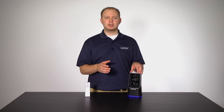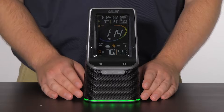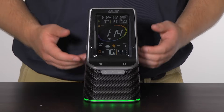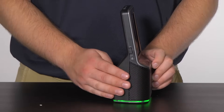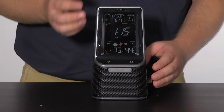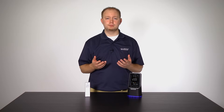For the backlight adjustment: if connected to the AC adapter, you have the ability to control your screen's backlight brightness. Press and release the snooze/backlight button on the top of the station — with each press you will cycle through high, low, or off. Once you find the setting you like, just leave the screen as is and it will remain at that brightness level. If running on battery power only, the screen's backlight will remain off unless the snooze/backlight button is pushed, which will boost brightness to high for 10 seconds. Note that when searching for the atomic time signal, the backlight, rim light, and USB charging port will turn off briefly to avoid interference.